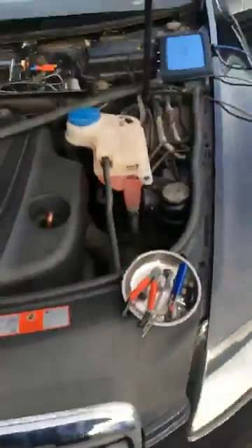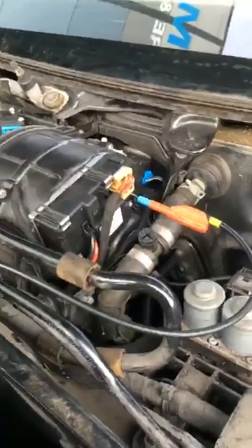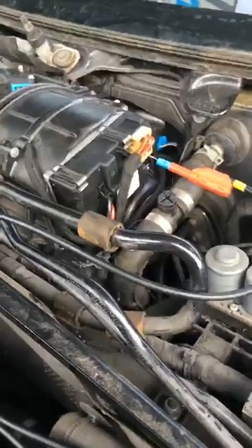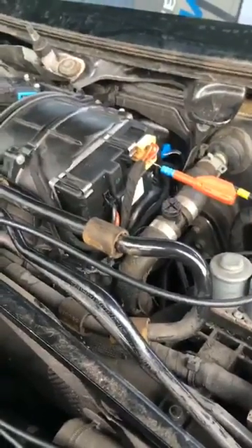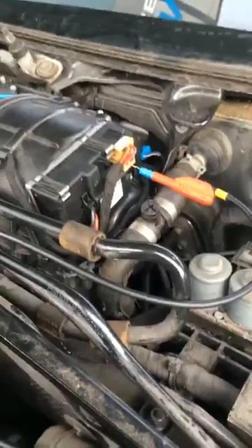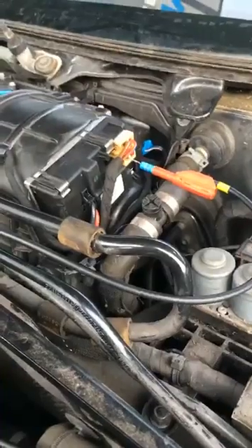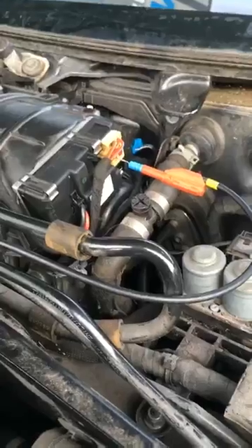I just thought I'd share that — it's not a system I see every day. There's no heater resistor in it; it's all done via a data bus. We'll get this bumper off — might not be today — and do some more testing. My strong suspicion is that the refrigerant pressure sensor is shorted to positive, basically sending a 12-volt feed constantly to the control module. Thanks for watching.